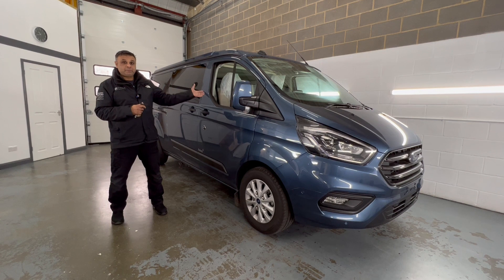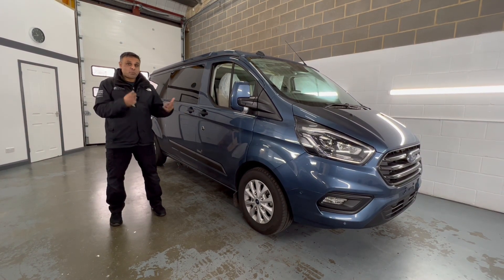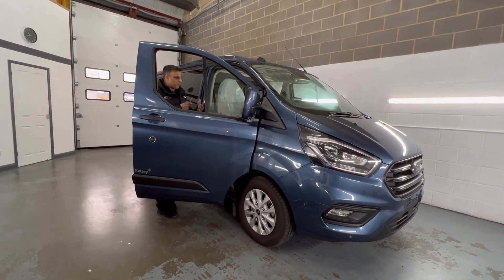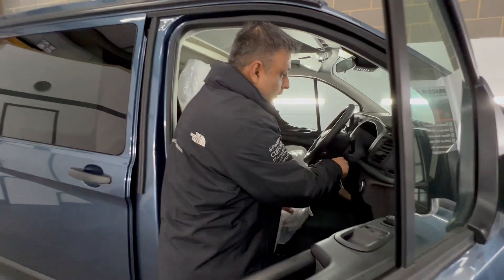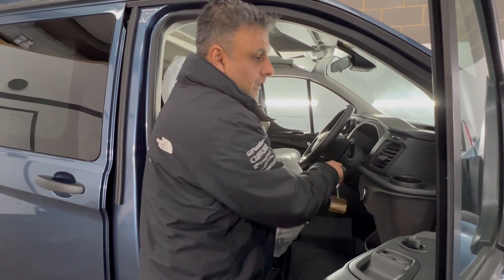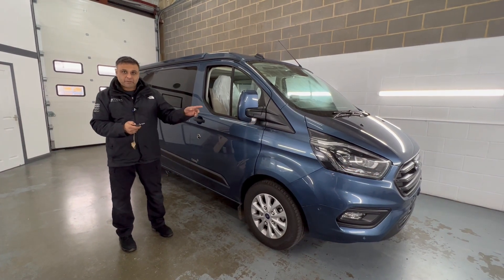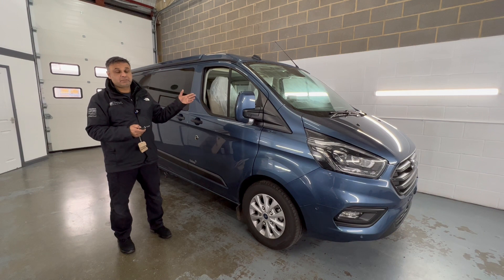You can arm the alarm system with the interior sensor switched off. Being a Ford Transit, it has its own way of doing that — you turn the ignition on and off three times. It sounds a little bit of a pain, but it's literally just on and off three times. You get a high-pitched sound, then lock it, and you get the high-pitched sound again — that means the interior sensor is now deactivated.